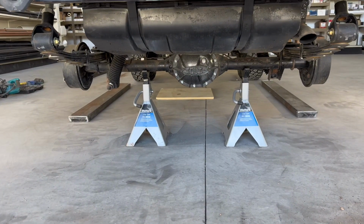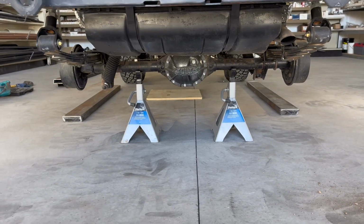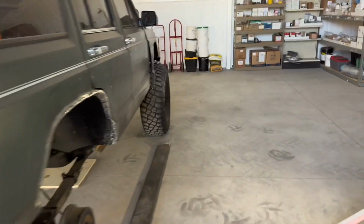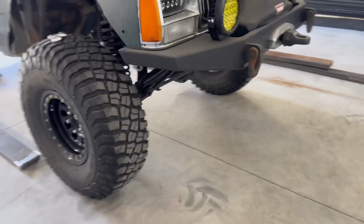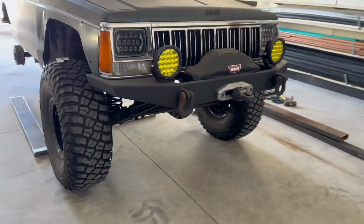Still got the Dana 35 under there. We'll be pulling that out soon and gearing his Dana 44, putting a locker in the 44 and then bolting that in. And then we still have the truss and gears to put in his Dana 30 here. We're gonna leave the Spartan locker in the Dana 30 and roll with it, but we're gonna truss, gusset and all that jazz.